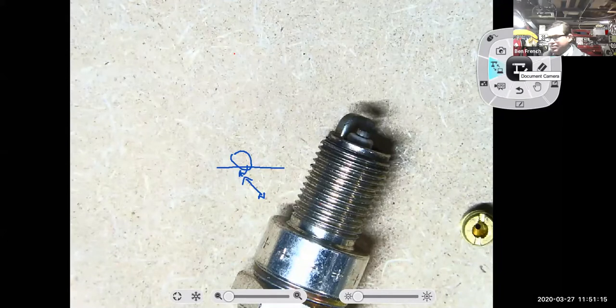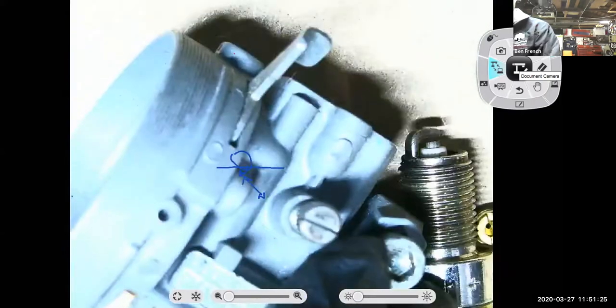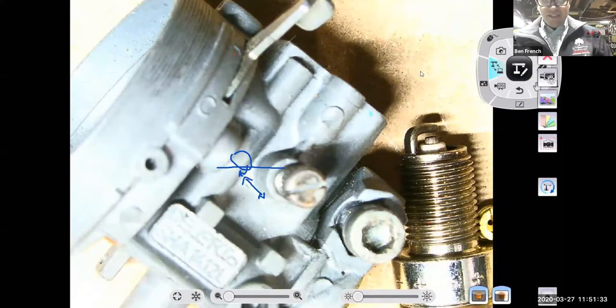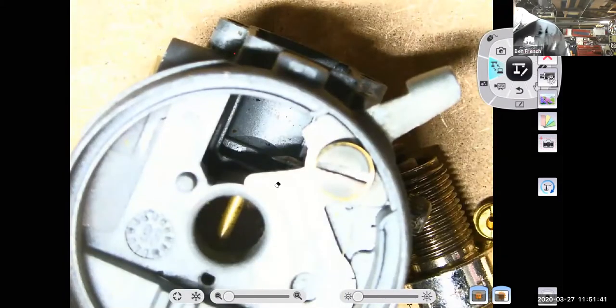Yeah, so it depends. The carburetor I had here doesn't have a slide in it, but what I think is that the slide wasn't closing enough. Or your other option would be that there's a vacuum leak letting air go into the engine and not have to go through the center of the carburetor. So it would take some inspection and diagnosis, that's for sure, to figure out what's going on.